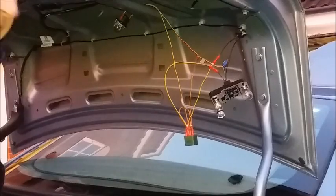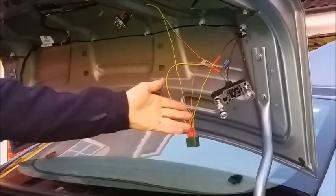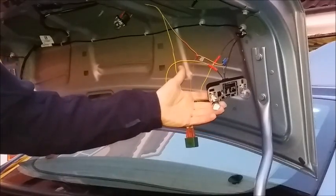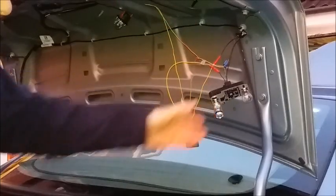Now you can see that when I switch the ignition on, the electronics checks all the bulbs and the check is okay — no error. The ignition is now on. This bulb is not lit but is acting as a resistor; the car can see that there's a bulb connected so there's no error message. There's the LED in place in the bulb holder, which I've just dropped out of the light unit so you can see it.